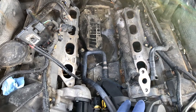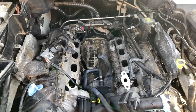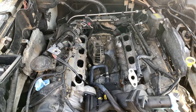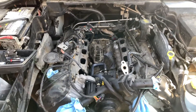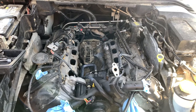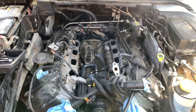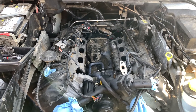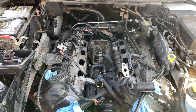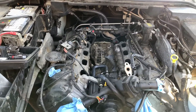Last night we replaced parts, cleaned up the surfaces with brake cleaner, and we're gonna reinstall the intake manifold and get everything back together to see if this thing won't overheat anymore. We're still waiting on that rear cooler lines. What we'll do is get it running, check the air suspension to get it up off the ground higher, pull the fuses out, and then try to dig under there and pull the heater lines going back to the heater core.